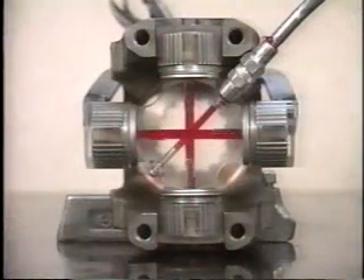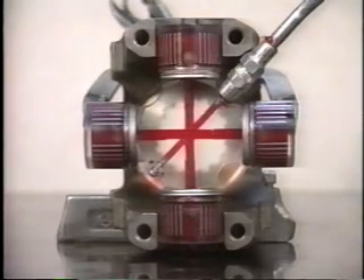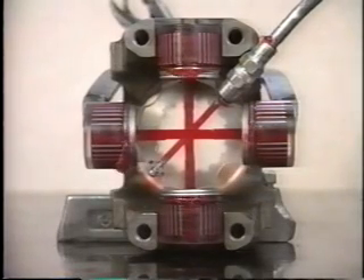After all four seals are purged, install new bolts and torque to specification. To ensure proper lubrication of a universal joint, be sure that the entire lube path from the zerk to the bearing seals is full. This can only be accomplished by purging all four bearing seals. For further information, see your Spicer representative or call the Spicer support line at 1-800-666-8688.